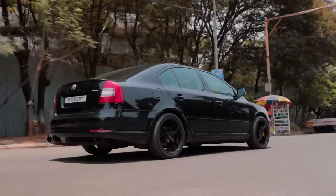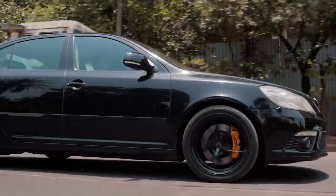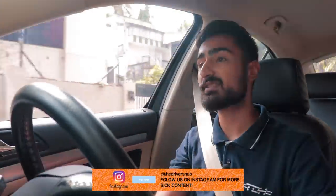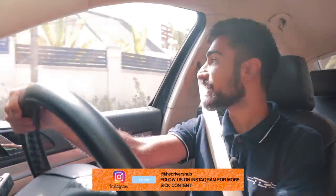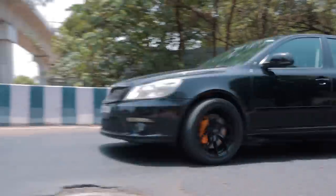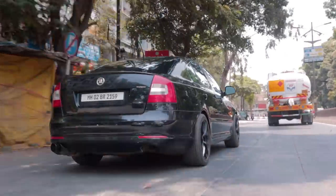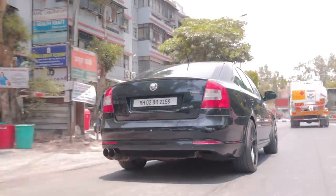All of that power only to the front wheels sounds a bit stupid, and it would be — but to support all that power, you've got a mechanical LSD. That upgrade costs around 2 lakh rupees, and the gains are pretty worth it because now while entering a corner and chucking it quite aggressively, the car stays pretty flat because the LSD works alongside all of the new suspension and makes the car feel very, very poised in a corner. Because you're pushing out so much power at the exit, when you punch the car at corner exit, you can feel the LSD actually clawing its way through each individual wheel to find the most grip possible and to keep you away from the sidewalls.